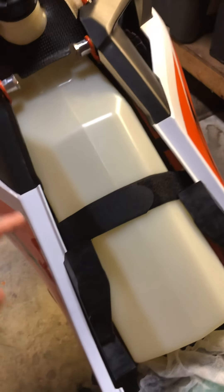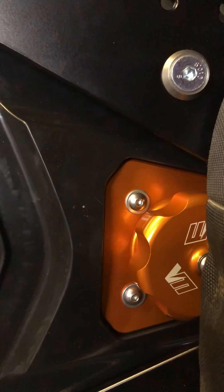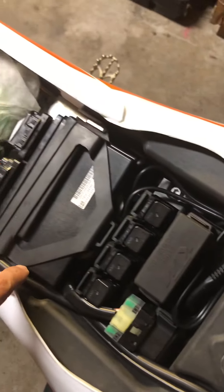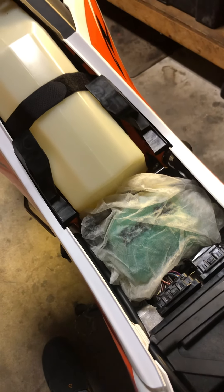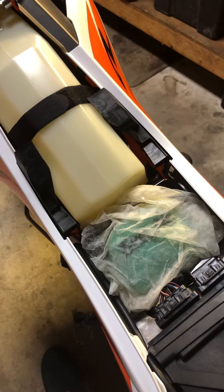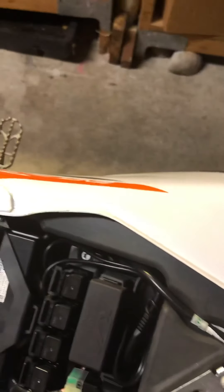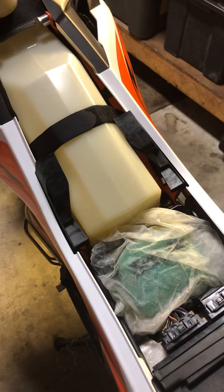What I did is I did not integrate this into the existing fuel pump system. I basically ran a hose from here all the way down — here's the hose — and I just plugged it into this Finichi billet gas cap system. I did not use the hose that came stock with the Raid Garage; that hose was actually too large in diameter. So I went to my local bike shop and bought about a meter of 3/16" fuel hose and zip tied the ends to each point. I had extra excess hose so I just cut it off.